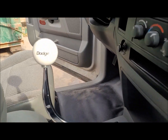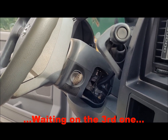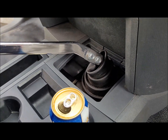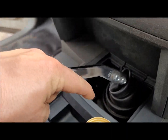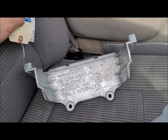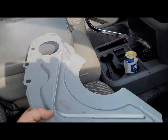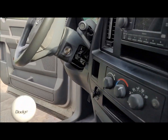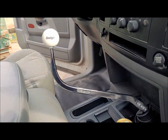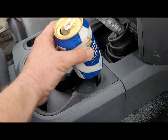Alright, halfway house — made a little bit of progress, but it's been raining off and on and I've been sick for the last week. I ordered the column pieces twice and got refunded both times — one from some Mopar online store, one from eBay. Might have to go straight to Dodge for that one. I did get my boot on order, but it was the boot only, not the bracket that forks under there and snaps in back. Everything indicated this was supposed to be the right one for the G56, but it appears to be the same as the 545RFE. That mount I believe is going to work — it's a 48RE mount. This does appear to be the correct lower dust shield for the G56 to Hemi. I'm gonna fab this up to the cross member once I can get back on it.